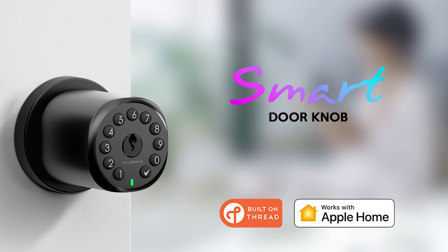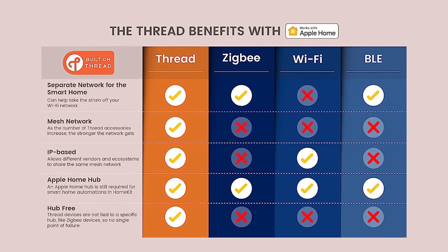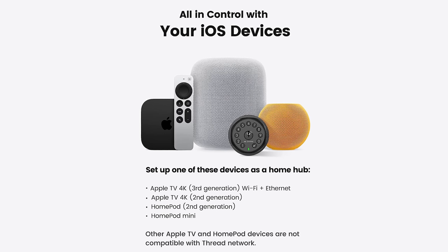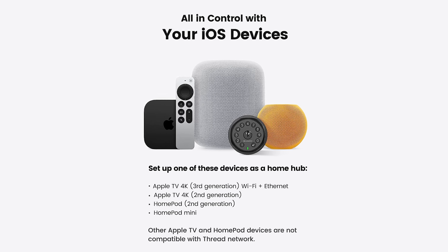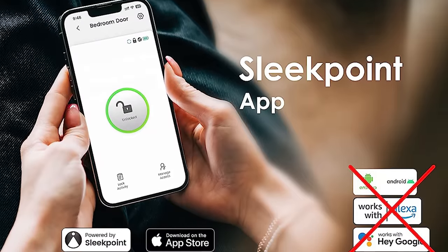The Secura smart doorknob is available right now on Amazon. It works with Apple Home over Thread. Thread is a wireless mesh protocol that is quite reliable and fast and does not require an additional hub like you would need with Zigbee or Z-Wave devices. It also supports Bluetooth, which is used for the initial setup or as a fallback if there is no Thread network available in your home. You will need an Apple Home Hub that supports Thread — like a HomePod, HomePod mini, or a compatible Apple TV — to connect it and take advantage of that Thread capability. It does only support Apple Home currently, with no support for Alexa or Google Home. Support for Matter in the future is possible, which would bring support to those other platforms, but there have been no official announcements regarding if or when that will actually happen.